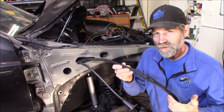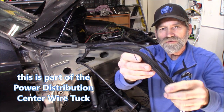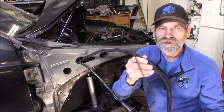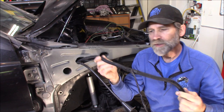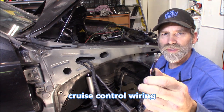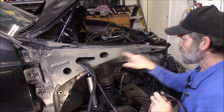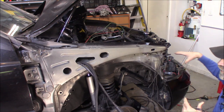I've got all the necessary wires passed through the chassis - you can see them coming out right here. I went ahead and covered them with braided split loom. I'll put a link in the description below for this stuff - it does a nice job and looks better than the original split loom with all the little ridges. This is a much smoother look. I took all the connectors off everything. I'll do another video on how to unload these connectors since they vary from one connector to another. Ready to pass it through these two holes - this one for cruise control, this one for everything else.